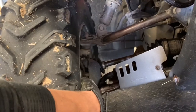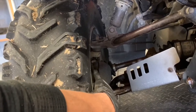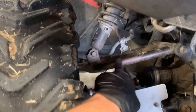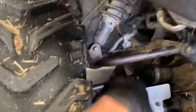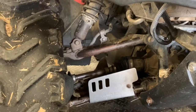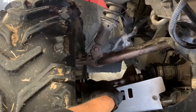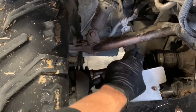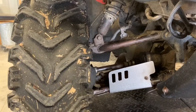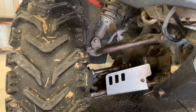On the front, you've got hydraulic disc brakes, so you've got a caliper on either side, and those pads you want to check periodically. Behind the upper A-arm here — the right-hand upper and lower A-arm — is a tie rod, and those have to be adjusted periodically. You also want to inspect those joints on there to make sure they're in good condition; you don't want those running loose. I also like to check and inspect these CV boots — there's one here and on the other side — make sure they don't have any rips or tears. Catch those early and replace the boots so you're not replacing those joints.